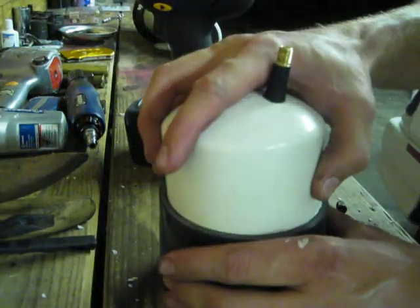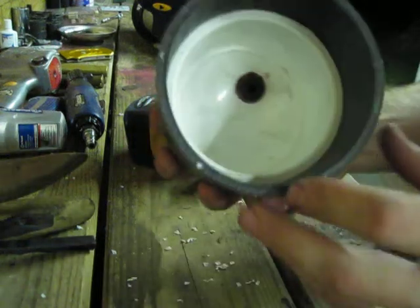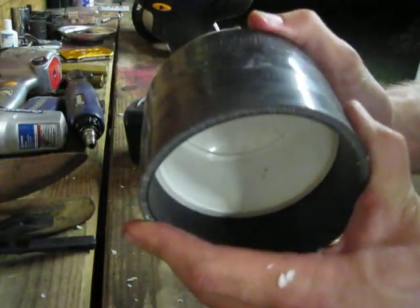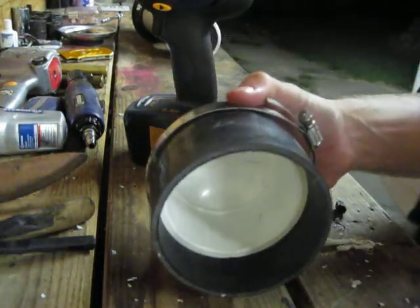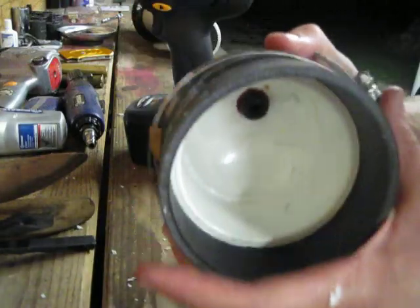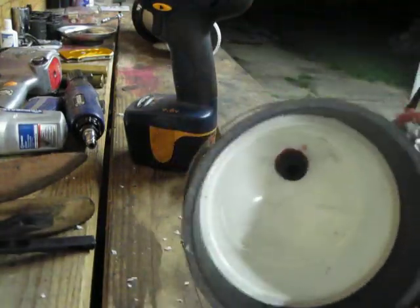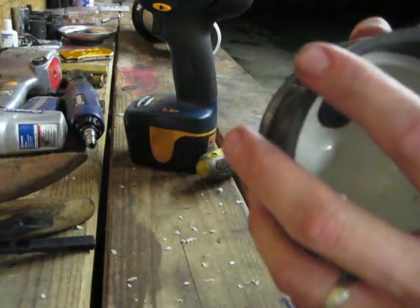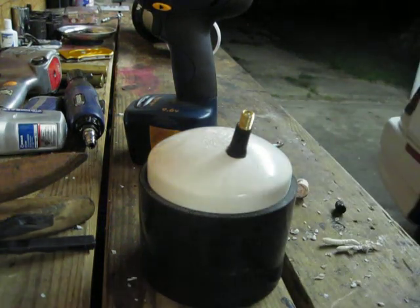Then you just get your coupler — this piece fit in there really snug, that's why I decided to use it. I'm going to leave enough for the turbo to sit in there, so I'll put it about halfway. You put one hose clamp here, then put this on the turbo, tighten it down, and apply pressure. I'll demonstrate that in the next video — how to apply pressure and do the boost leak test. I hope this helps.